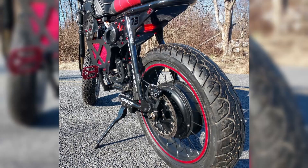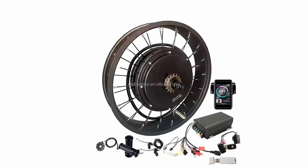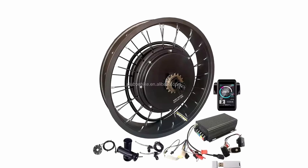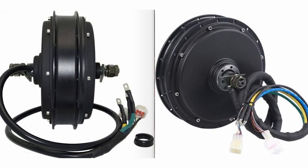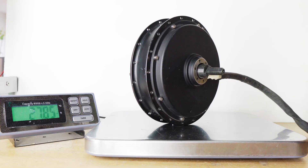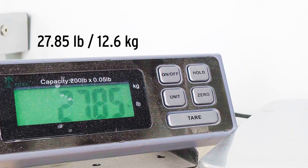At the other end and more on the DIY side, you get a lot of people doing fat bike conversions with really heavy fat direct drive hub motors. There are many generic companies making these motors with 50mm wide stators. They provide the option for regenerative braking and a robust motor drive, but they weigh a ton — typically 20 to 25 pounds just for the motor alone, and at that point a fat bike is not so much a bicycle as a moped.